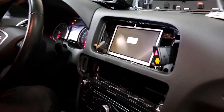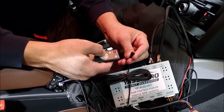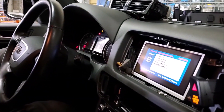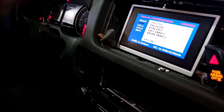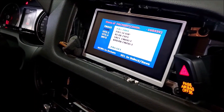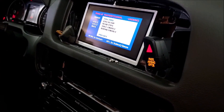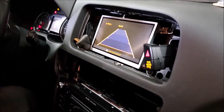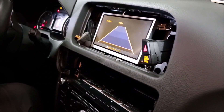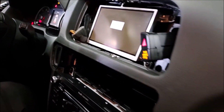Now I'm going to press on the mode button — it will take me to the first option. I'm going to take the remote in front of my infrared and hold the button to the left, and then we have a menu that opens. The second option here is the park type, which means if we want to have the lines moving with the steering wheel. So I can do either not used, park off, or park on — park on means the lines will move with the steering wheel, not used means no lines at all, and park off means steady lines. The next option is park setup where I can move the lines left and right to different positions.